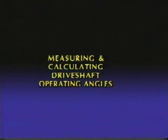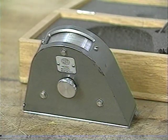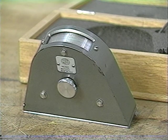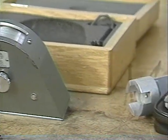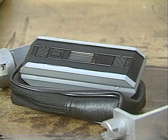In this video, we'll experience the measurement and calculation of a common driveshaft application. To measure the driveline slopes used to calculate the working angle, you will need a protractor. It must be capable of accuracy to within one quarter of a degree. Usually this requires a spirit level protractor, or better yet, a digital protractor.